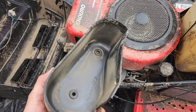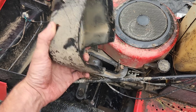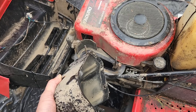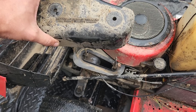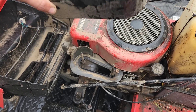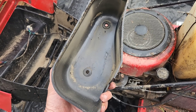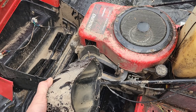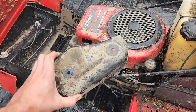So if you're ever dealing with these filters, they are the same exact size as a 12-horsepower Briggs and Stratton. All you do is line it up on there, drill some holes in it, put a piece of tape over the center hole, and it works. The Tecumseh one will cost you like three times as much as a generic one for Briggs and Stratton.